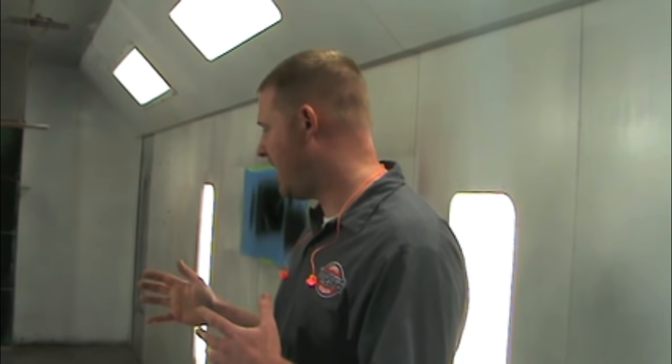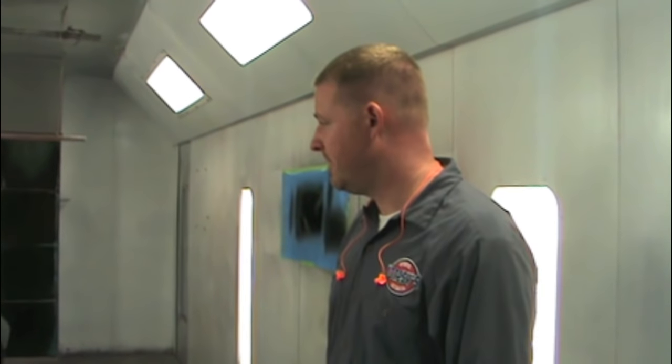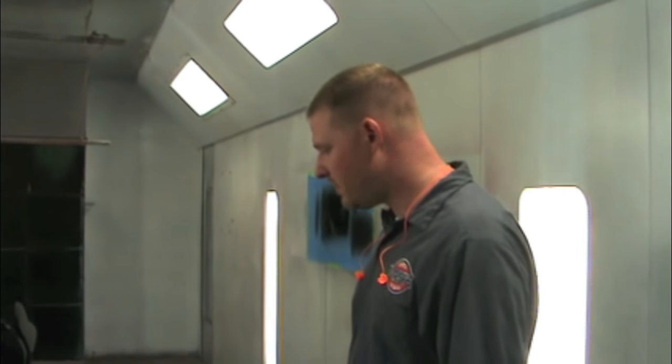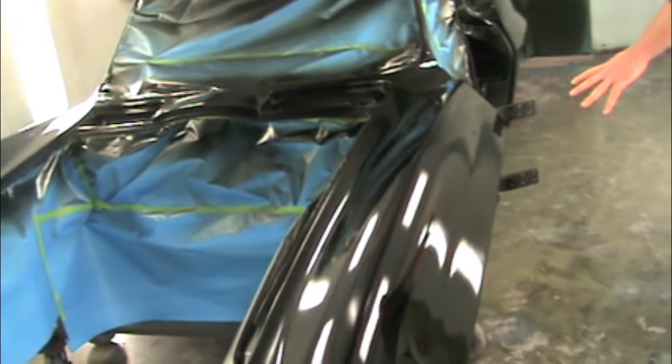keep vaporizing off so that all those solvents don't get trapped underneath by the next 4 coats that I put on it. On top of that, after an hour, if there's a big piece of crap or dust or something inside the paint, you can actually go and now very, very gently wet sand it out, and then all the next four coats will cover it.